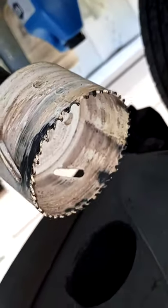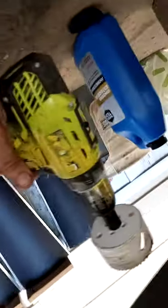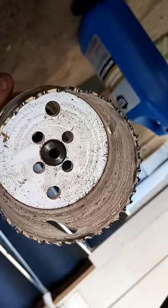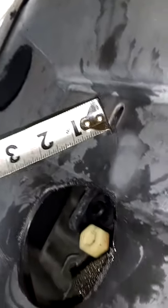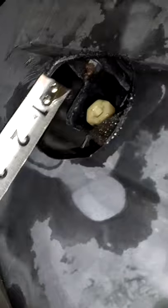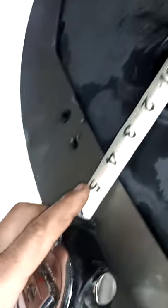So how do you use a hole saw? Very carefully. These things have very sharp edges. I accidentally cut my hand on one once, and it took several weeks for my fingers to heal. I use a variable speed drill. There's a center drill bit that's usually on these, but I don't really recommend you use the center drill bit, because if you push up, you're going to hit that plug. You can go off-center. All you need is to be able to access the plug. In my case, there's a hole on the skirt that goes directly toward the plug, and the center of the plug is about four inches off the fender cover.